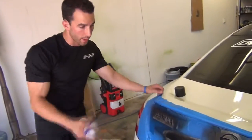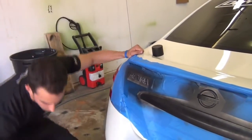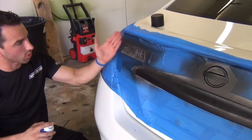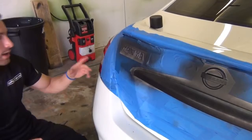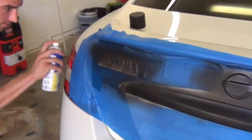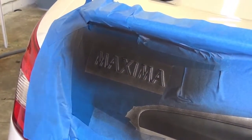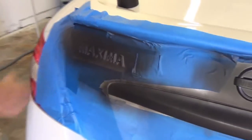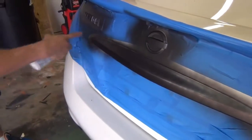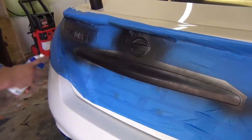One of the most important things is to go all the way up onto the body of the car into the tape so that we have a nice thick strip to pull off when we're done. Now for coat number two on the back emblems and chrome strip, I want to think about my angles. If I came at it from a straight angle on the first coat, all the side edges haven't been hit yet. So for my second coat, I'm going to come in at an angle all the way across. This big piece of chrome I'll just stay straight at because it doesn't have any hidden edges.